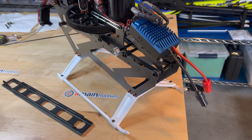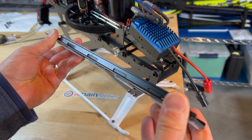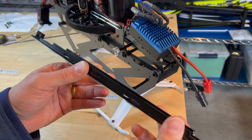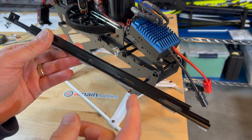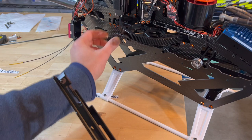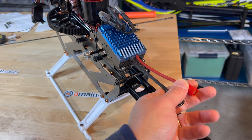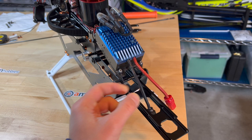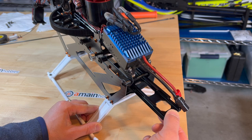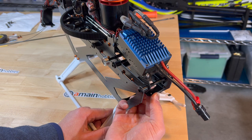This battery tray locking mechanism is one of the better ones I have seen in some time. The battery tray is made of aluminum and it's very, very stiff, so you can make an argument that it's not only serving as a battery tray but also working as a structural mechanism in keeping the helicopter rigid. The locking mechanism just pulls in and out, and the pin locks in this big hole. The battery tray slides very easily forwards and backwards, but there's not much lateral play, and as you push it, it just locks. The forward-aft play is maybe about half a millimeter.